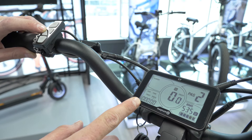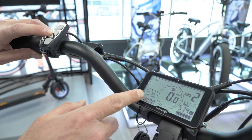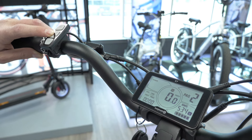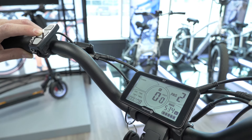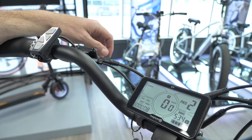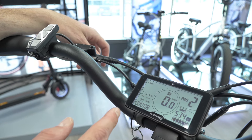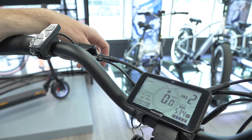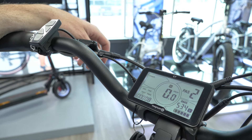Over here, you can see right now it's selected on trip two. You actually have two trips. You can see the different settings displayed by an underline — this is the time, your trip time, your odometer. This is obviously a fresh bike with zero kilometers on it, and this is trip one. On the right side, you can see your battery indicator level. The notches show it's full, but for a more accurate reading you can see the voltage, which is 53.4. In general, 54.6 will be a full charge. When you get to 47, the battery is starting to get really low, and 45 is dead.